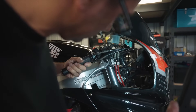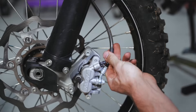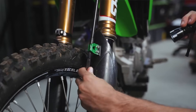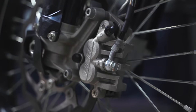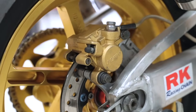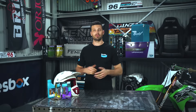If the issue persists, inspect the bike's braking system for any leaks. Take a close look at your brake lines, your brake calipers and your brake master cylinder. Look for perished or swollen brake lines, fluid weeping at the fittings on the calipers, or any wear or corrosion and any potential leakage at the master cylinder. If you do find any of these issues, have them rectified and then you will be able to start the brake bleeding process.